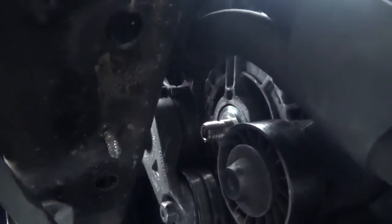There are the threads. Come up in here and just thread the new pulley on. I thought about putting some anti-seize on it, which may not be a bad idea — I might actually go ahead and do that. Threading it on now — no way to show exactly what I'm doing but I'm basically just threading it on by hand, then I'll tighten it up with the tool.